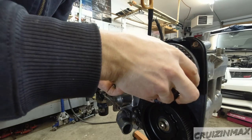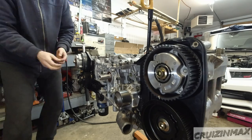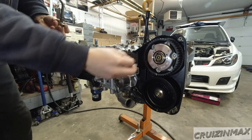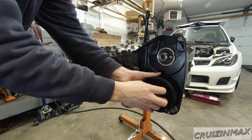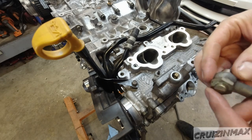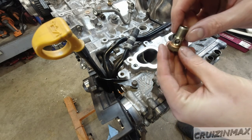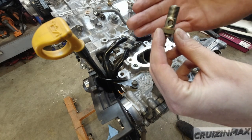Intake sprockets get new o-rings. Another mistake — this oil line goes behind the timing cover, so I've got to take the sprockets off, take the timing cover off, and then put the line in. It turns out one of these bolts has a filter inside — it does look different. I cleaned the inside, sprayed brake cleaner through it, and now I can actually see through it to the light. Nice and clean.